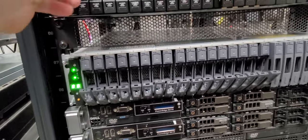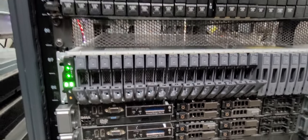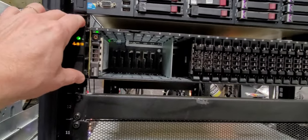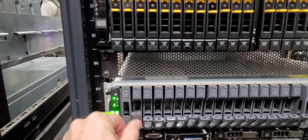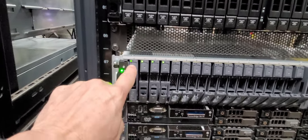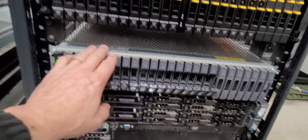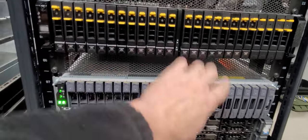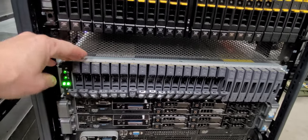So with that being said, these disks down here will provide us a very easy, sequential-order process. What I mean by that is, when I'm ready to bring them online from up here, and the SAS controller is connected and ready to see disks, I'll be pushing channel one bus in first, and then channel two bus, and channel three bus, and channel four bus. And the beauty of that is the system will synchronize the drive IDs correctly. If I had just put all these disks in here, and all these disks in here, microsecond-wise, some will come up faster than others, so suddenly your IDs are flying all over the place, and your disk assignments aren't coinciding. That's the nice thing about NetApp or Dell EMC and so on, they'll do this for you if you buy a brand new array.